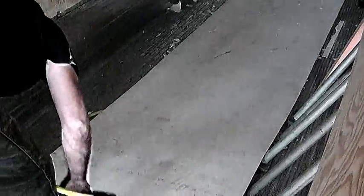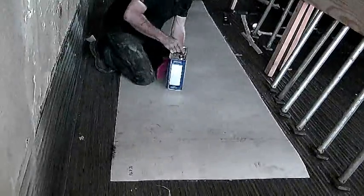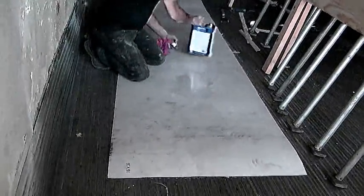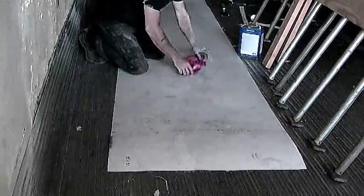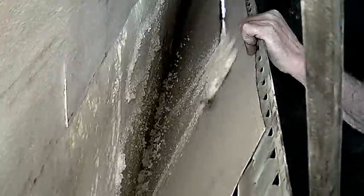Before you mount the panel on the wall, you need to spray it off with air to get rid of all the dust. In order for the adhesive to bond the fiberglass to the foam, you need to clean all the surface of the panel to remove any grease and grime. After you have set the panel into the scuff plate groove and aligned both ends, spray the fiberglass adhesive on the wall and on the panel. Use the same kind of applicator gun that you did with the foam. If you use the foam applicator gun, make sure that you clean it out first with a cleaning can — you cannot blend the two chemicals together.